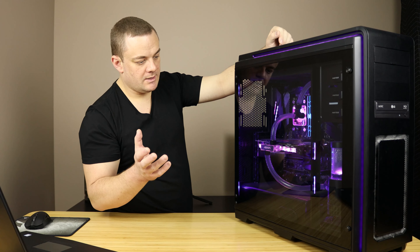We're draining the rad by tilting the case back and forth a few times until we get as much drained out as we can. Be sure not to make the mistake I just made by marking up your desk — get yourself a towel to put down underneath it. After a few minutes of tilting, it looks like we've got most of the liquid out of the loop.